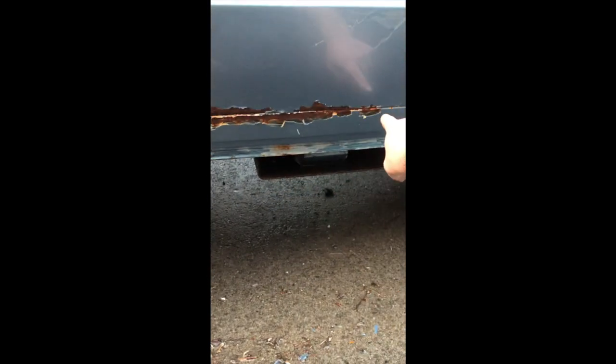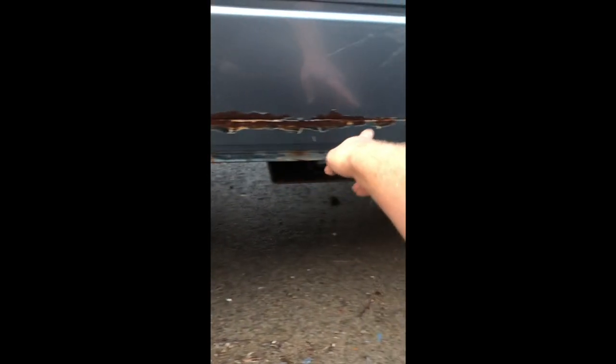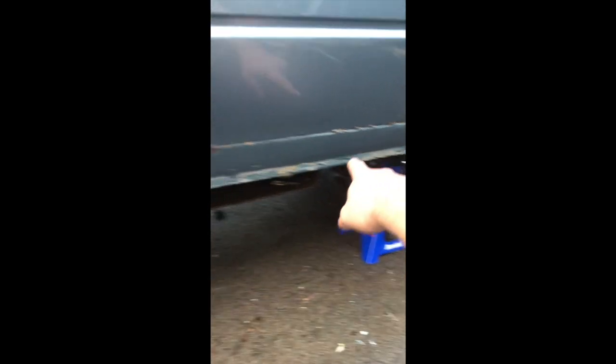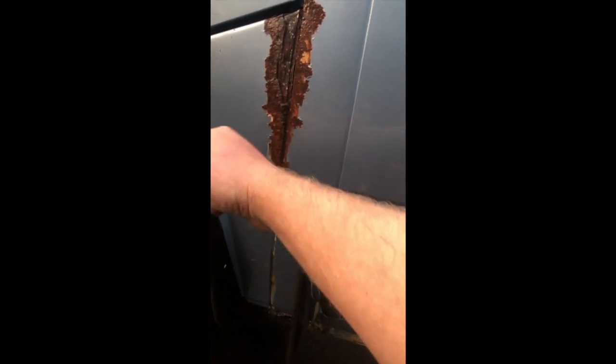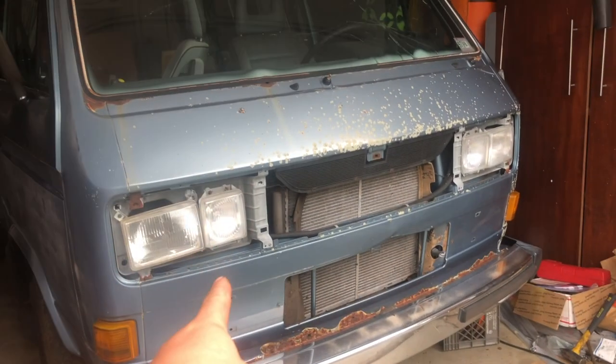I just blasted all this and that's all the paint that came off. I don't think this seam rusted out — I think the paint just failed right here. I see no reason at all to replace this panel; it looks completely solid. It was a paint failure. This side looks totally solid; that side needs replacement, but that's the only big issue.